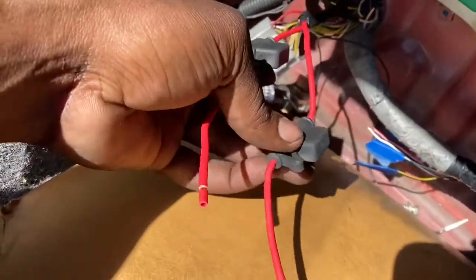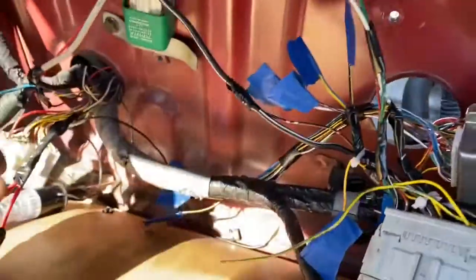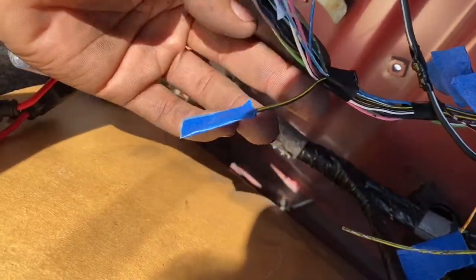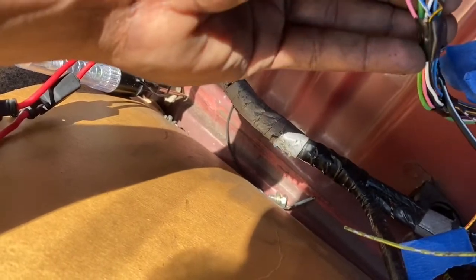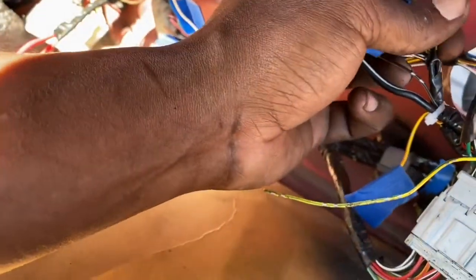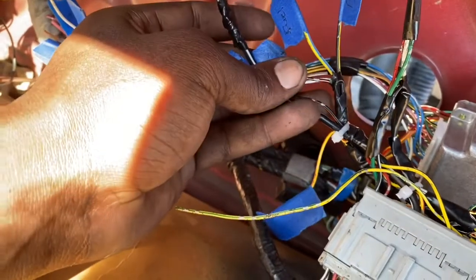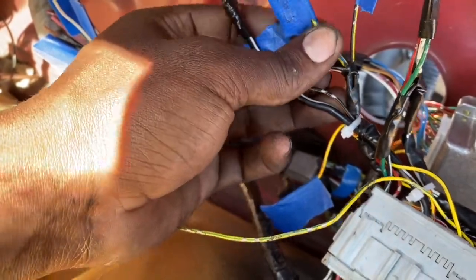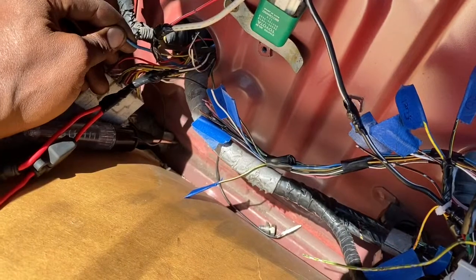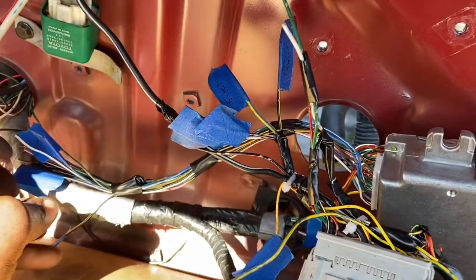I got it fused and I did my main power as well — that's the power that stays on all the time. That's gonna go to this black and yellow wire. The other three I'm gonna tap to the white switch power, and with that I can tap my fuel — this relay should be working and that goes to the blue and black wire. So we should have fuel, and after connecting the three wires and the other main switch, we should have power to the ECU.